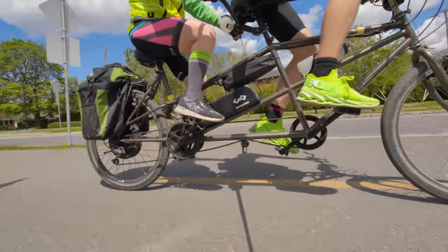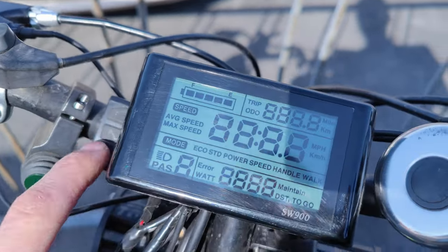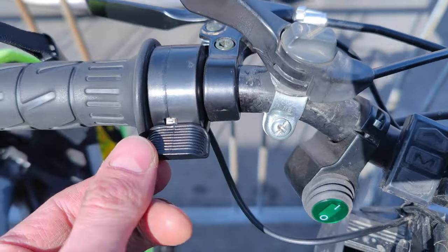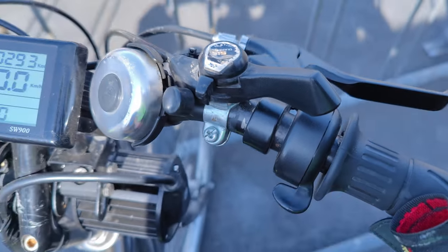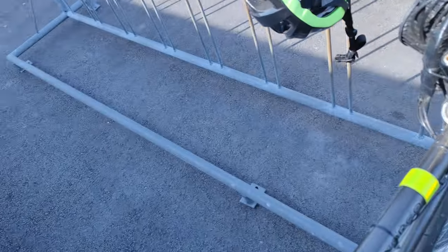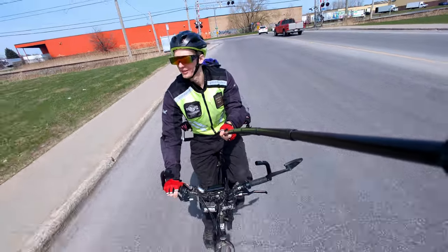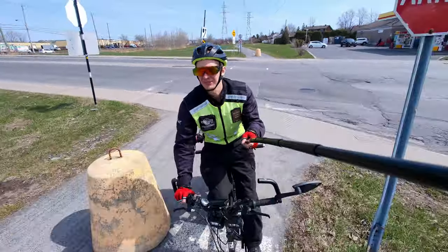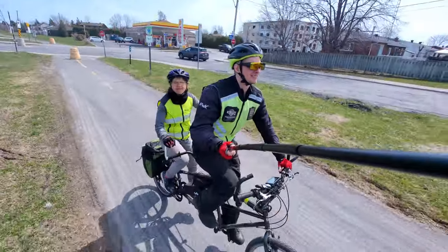So I've done a little workaround: I turned off the pedal assist completely and added a secondary left throttle. I removed the spring from that throttle so it acts like a bit of a cruise control, allowing me to set the speed and power I want without any delays.